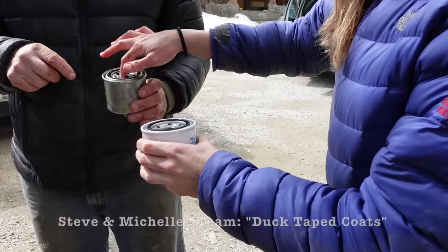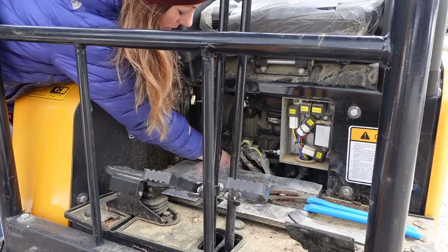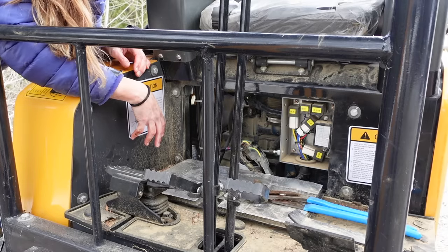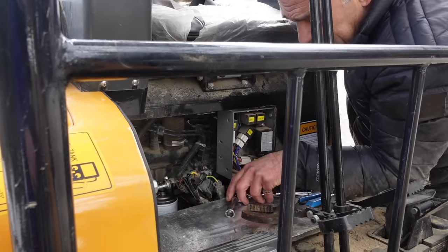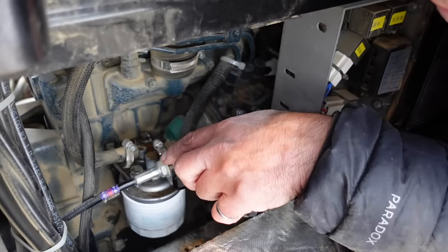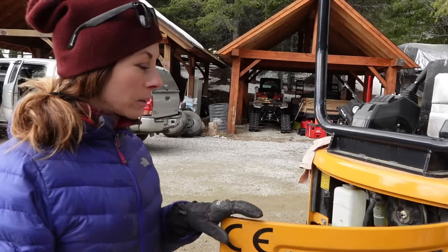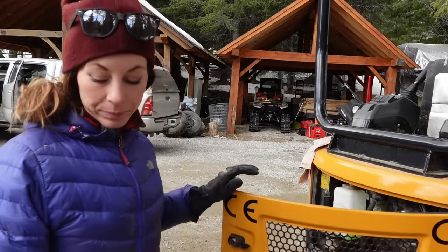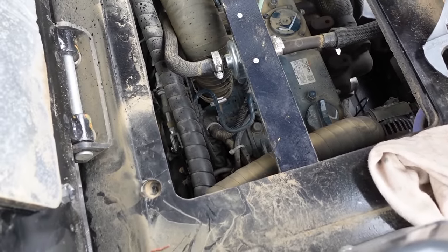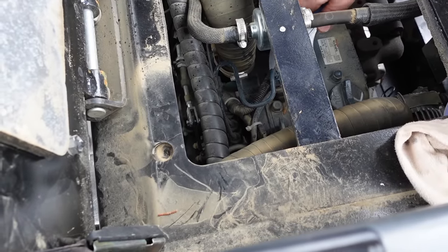It looks clean. Put some fuel in, put it back on. See this top up here? That's the bleed — you've got to get the air out. Loosen this... it is loose. Turn the thing on, filling up. You want the bubbles to come out; you want to see a good flow of fuel. So the next thing to check is the fuel injectors — maybe those are clogged a little bit. The fuel is going there — you can see it squirt up — that's injecting into the cylinder.